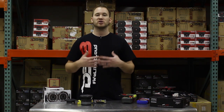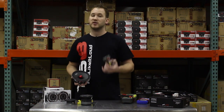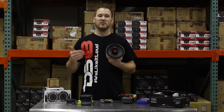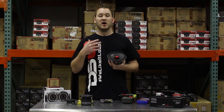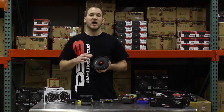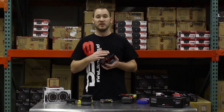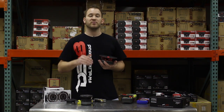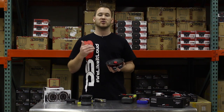If you're running off a factory or aftermarket radio without an amplifier, make sure you get a smaller tweeter that performs better with less power. It's always a good idea when upgrading to large tweeters to use an amplifier — that's the best scenario. A lot of people shopping for tweeters are also going to need a speaker to go with it. Most commonly used with a two-channel crossover is a mid-range speaker. A mid-range speaker doesn't have a tweeter — it plays mid to slightly lower frequencies, not the bass frequencies a subwoofer does, typically from about 100–200 Hz up to 10,000–15,000 Hz.